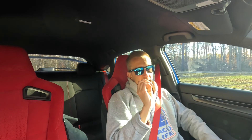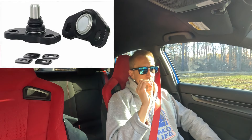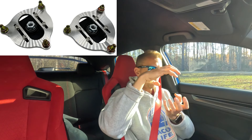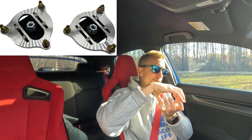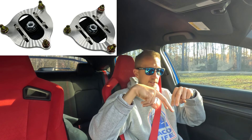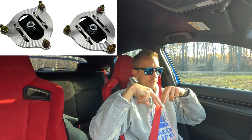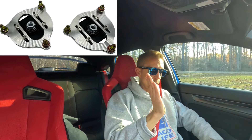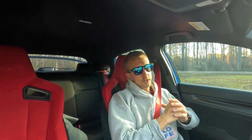You can address camber with adjustable lower ball joints, or aftermarket adjustable top hats that replace the OEM ones. The aftermarket top hats use four Allen-head screws with a large slot — loosen the screws and you can shift the entire strut assembly inward or outward. I haven't decided whether to take that approach yet, but I'm happy with how the car rides now, so I'll monitor tire wear.